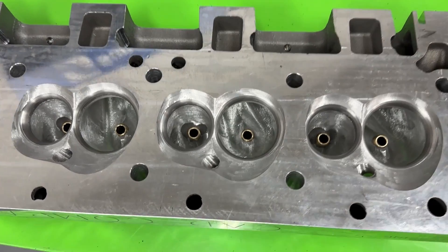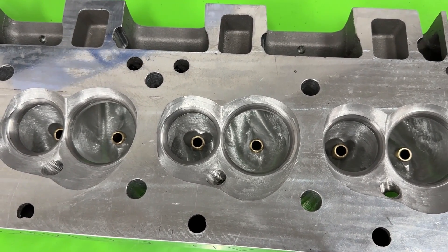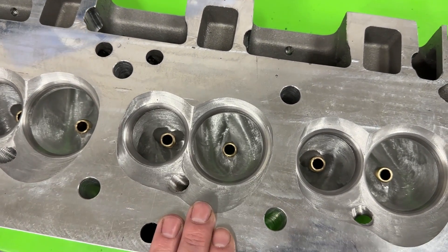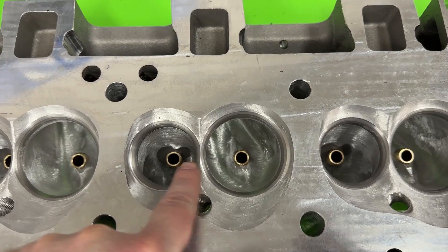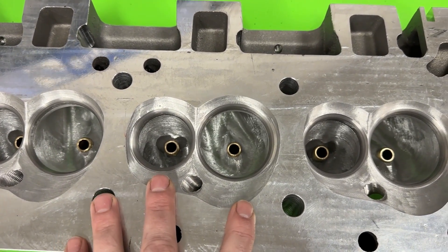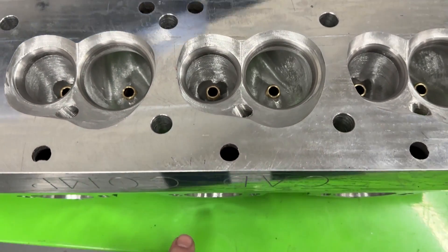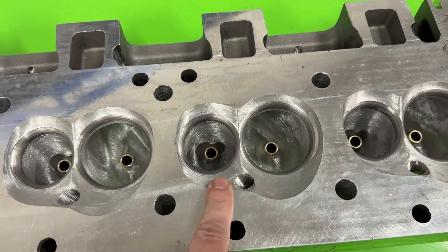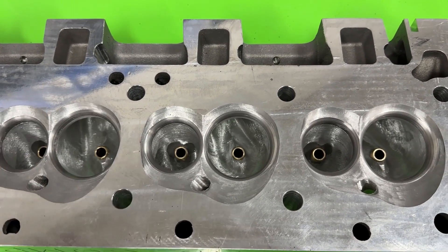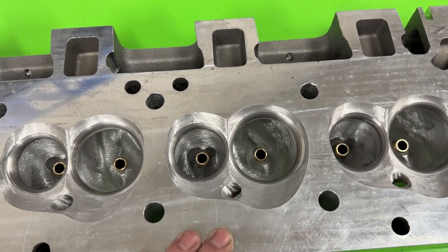So these are a dramatic improvement. Now, you may remember how I talked about the Mopar guys and said how your chamber sucks — this is how it should be. This Cadillac chamber is more of a modern design. The valves are in line, so it's a wedge. But this chamber design is much better. The bore size when I flowed this was like a 4.320. Courtney even went so far as buying a flow plate for me to actually be able to flow these, which is a huge deal — otherwise I wouldn't have it for just one customer.